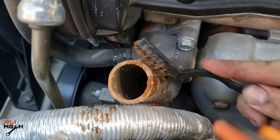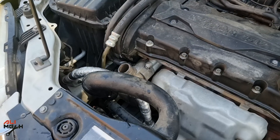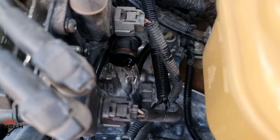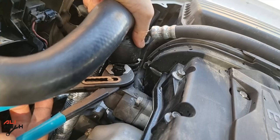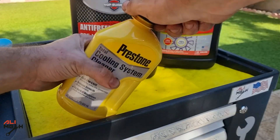With a simple brushing and using sandpaper, it went from this to this. Now we're going to use a garden hose and let the water run out till you see the water is clean. Then we're going to put the inlet and the outlet hose back, and now it's time for cooling system cleaner.